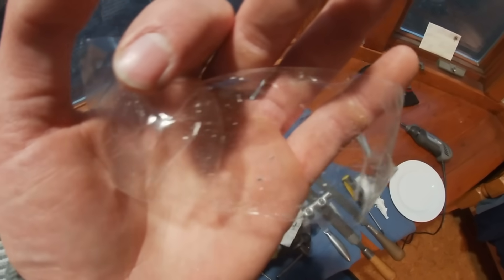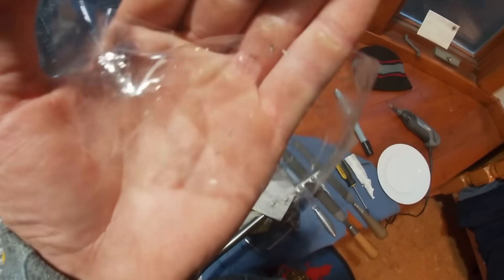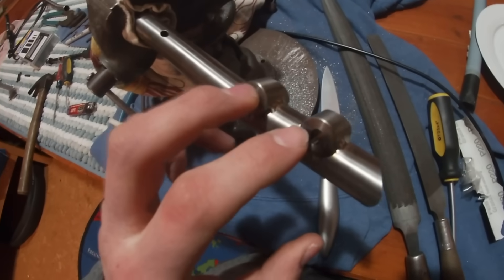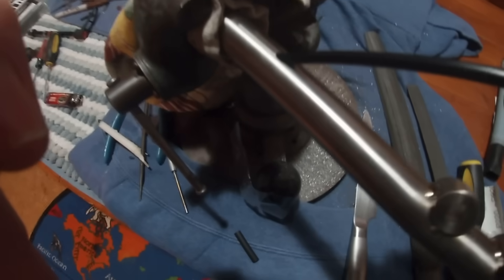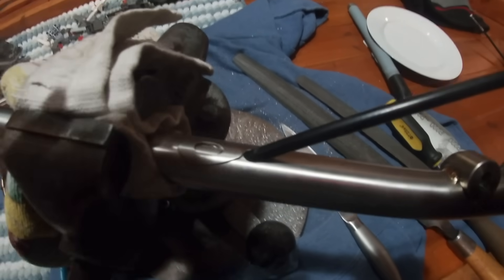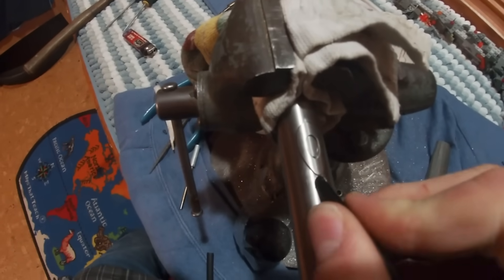Just peeled the tape off the head tube after drilling the hole for the brake line. Look at all those little grains of weight — those shavings we collected, just on the piece of tape, but we also vacuumed a bunch out. We've just drilled the hole here. This is the seat stay with the brake mounts. This hole is going to be for our brake cable — it'll kind of come in on an angle, right like that. We've got a little teardrop piece right here that will fit over the hole, just to add a little bit of strength for the strength lost in the missing material.